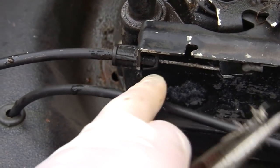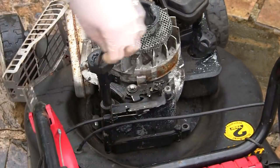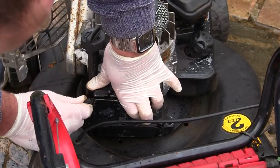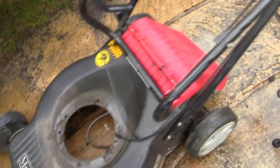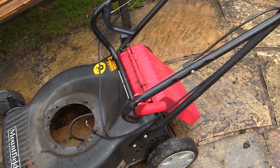To unhook the cable it's really quite simple - you'll see this catch here. All you need to do is squeeze these parts and it pushes back through this way. You don't pull it out - it goes back through here. So I'm going to squeeze that part, pull that cable out. Sometimes you can do this with your fingers - just squeeze these parts, push them back through like this, unhook the cable and it should just come off from underneath. That's it - I can lift the whole engine off and drop it on my bench. I've got this deck all loose now; I can turn it over, paint the underside, do whatever I need to do.